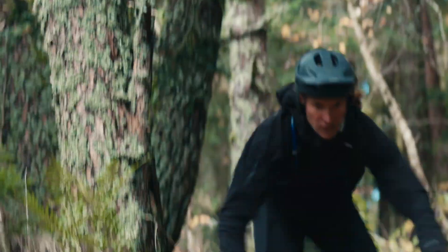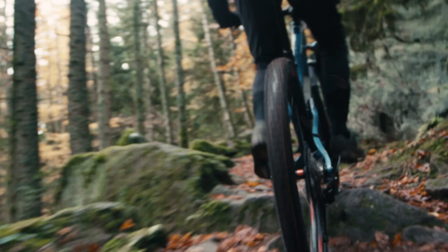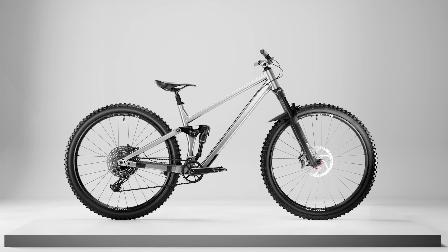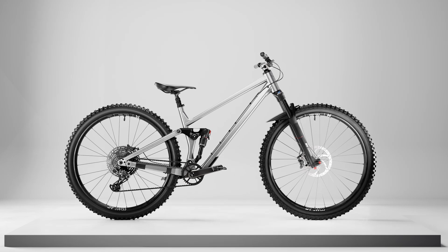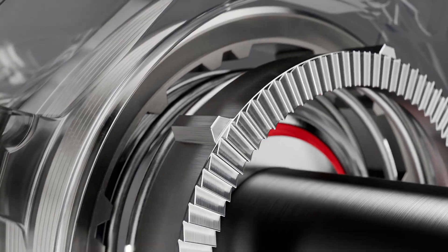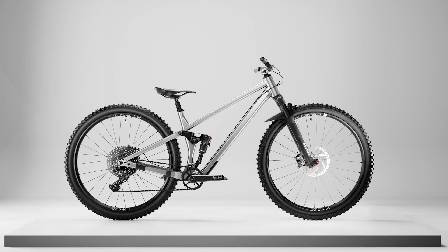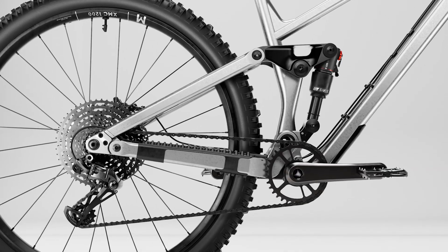Imagine you're riding on a rough trail like your home trail with lots of roots and rocks and therefore also heavy impacts. In those moments the effect of pedal kickback could occur on your full suspension bike. The DF system allows the freehub to rotate a specific range before engaging so that the influence on the rear suspension is reduced. That allows the rear triangle to work more freely and provide you with more control, balance and also less fatigue on the trail.